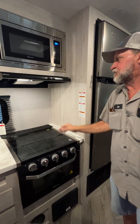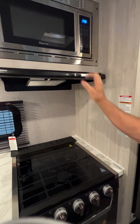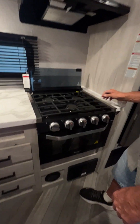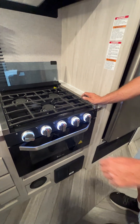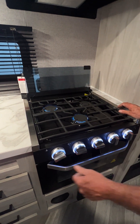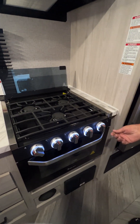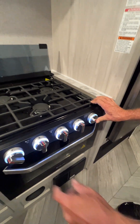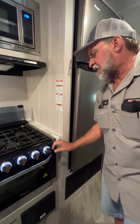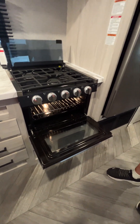We do have a light for the stove top and a fan. The glass stove top folds up twice and out of the way. The little button on the right-hand side illuminates the valves — you turn it to where it says high, then use the striker on the left-hand side to light all three burners on top. Same way with your oven: turn it to where it says pilot on, hold down on the button, and use the striker on the left-hand side for it to light. Once the pilot is lit, let it run for about a minute, then dial your temperature up to whatever you want. If you flip that button on the right-hand side to the lower connection it also gives you a light down in the oven so you can see what you're baking.